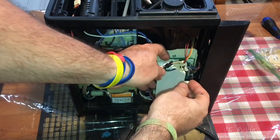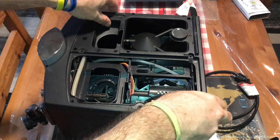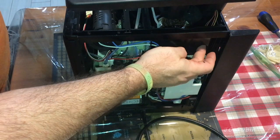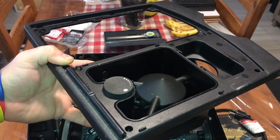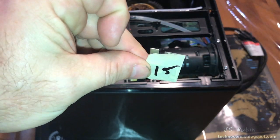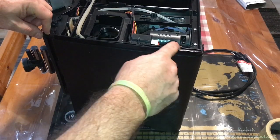I've annotated the bean sensor cable with number fourteen and now I'm going to disconnect that cable from the machine. Very gently pry the top cover off until it's released, then guide the bean counter cable through the hole — once it's through, lift the entire top cover off, which will be stored and later cleaned. I then remove this metal piece — just lift it right off the chassis, wrap it with tape labeled fifteen, and store it with the screws.